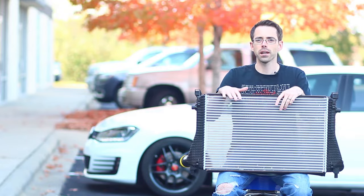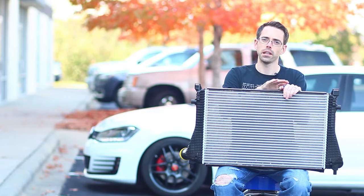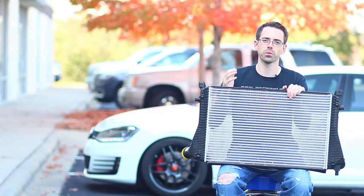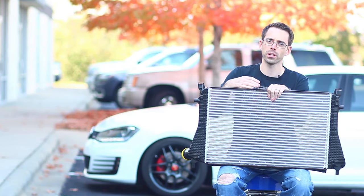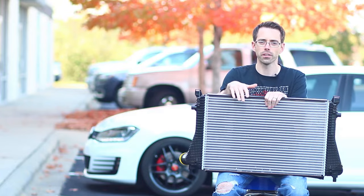If you have a bar and plate design, they are solid all the way through. Looking at this comparison picture, a bar and plate design is a lot smoother — the end tanks are a lot smoother. With a tube and fin design, the tubes run through the end tanks and at either end the tube will actually raise above the edge of the intercooler. This creates some flow problems — it's not ideal when you have a raised edge where airflow needs to enter, as it creates turbulence. A flat, flush finish like a bar and plate design promotes much better flow through the intercooler, less turbulence, and overall better efficiency.